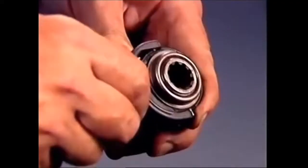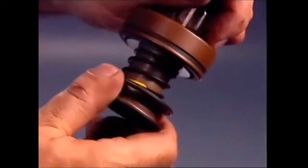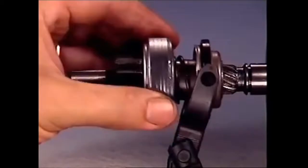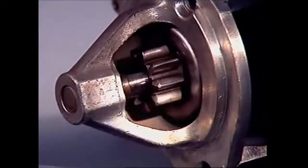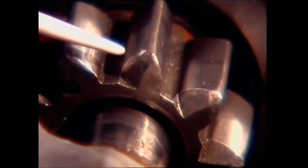The fork locates in a guide ring on a pinion driver which is coupled to the pinion via a roller type over-running clutch designed to transmit drive in one direction only. The pinion driver is mounted on a helix machined on the armature shaft to form a very coarse thread. This allows the pinion driver to rotate slightly when moved towards the ring gear, and together with a chamfer on the leading edge of the ring gear and pinion teeth, this is designed to assist meshing and easy engagement.